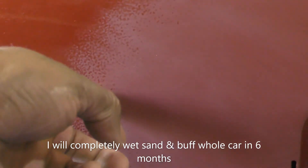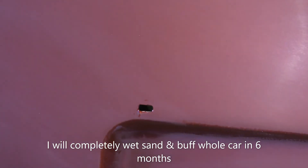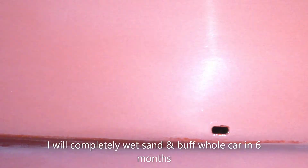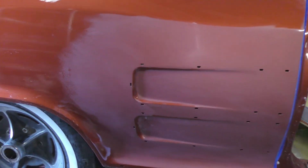Okay guys, so like I say, you see the roughness. When you wet sand — I'm starting off with 1000, I'm hand sanding this — that's how you want it to look when you get done with the 1000. I can see a few little spots that I can hit just a little more, but I'm not really focusing on this area up here. I'm just trying to get out around where my chrome is going to go, where I can put these pieces on. And then later on I'm going to come back and wet sand the rest of the car and wet sand and buff.